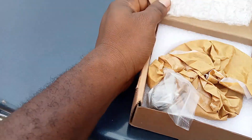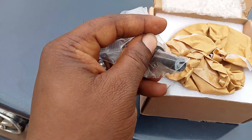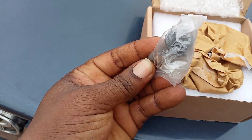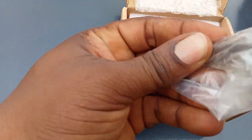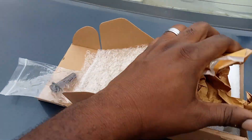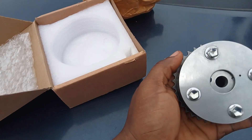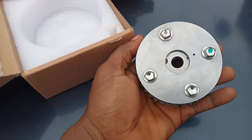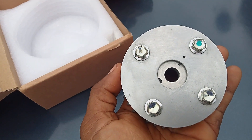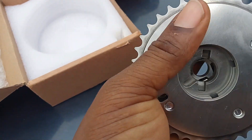This is the updated nut that goes inside the camshaft — don't throw it away or replace it with the old one. Use the updated nut that comes with it when you buy it. And this is the VVT sprocket. It's in the lock position, but it doesn't matter — you can install it either in lock or unlock position.